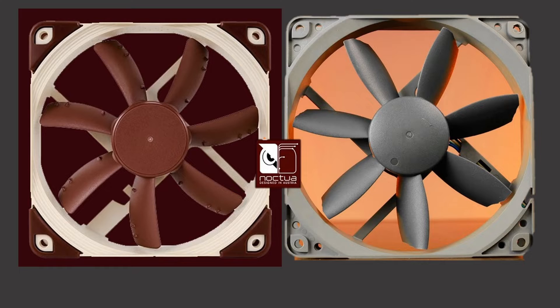We're going to go into all the data, charts, and graphs. My previous data set isn't technically incorrect. The main thing is that it didn't end up testing exactly what I wanted to test. The long story short is the microphone was placed really close to the tip of the fan blades, and I ended up getting interference between the microphone and the fan blades themselves — i.e., I was getting resonant frequencies, very similar to how the blade would interact with a fin stack on a radiator or a mesh filter.